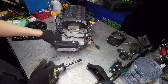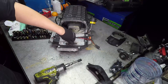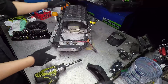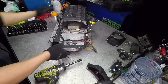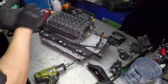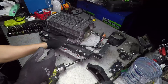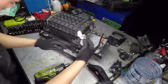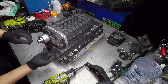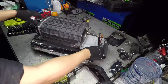This is where the water goes in and out of the built-in intercooler. I'm going to leave the nut there but I'll take this off. So now what it looks like is the supercharger is secured from the bottom and we're going to have to take these deck bolts off. We're going to have to open up the lid, so let's just start doing that.